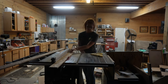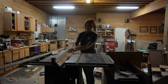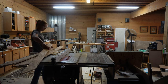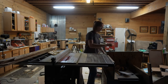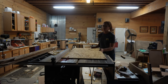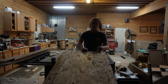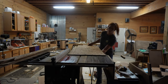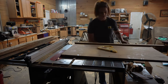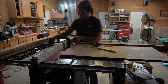I'm starting out by cutting some OSB down — a couple inches wide. You can really make it however thick you want. This is going to be the main frame that holds the window shade. I make one strip for each window, making sure I have enough for all of them. This one needed to be longer than my scrap wood, which is why I'm cutting that extra piece. I think there were maybe five windows in this camper.